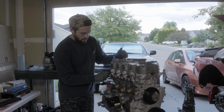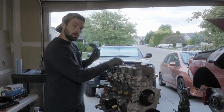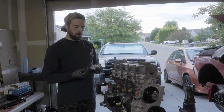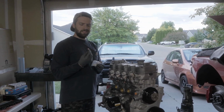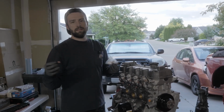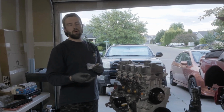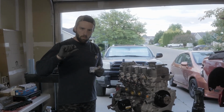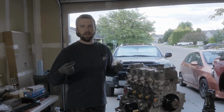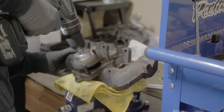And just getting them hand tight, getting them started here with the nut, which is also copper. Copper exhaust stud nuts are really common. You'll also notice they're slightly, in these cases, these ones might not be, but a lot of them are actually ovaled, and that operates very similar to a nylon nut on a skateboard or on some other parts of the car, where the more you torque it down, it's almost, I wouldn't say cross-threading, but it's locking itself in place there on the exhaust stud.